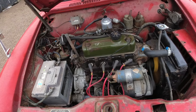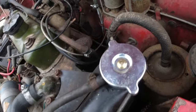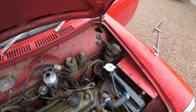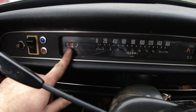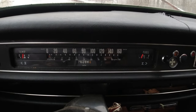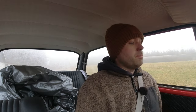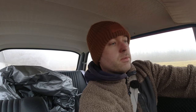It sounds so sweet, this little A-series — sounds really really good. Let's take it for a little drive. There are some private roads around here so no problem. We'll take it for a drive in the seat, see what it does, get a brake feel, see if it goes up to temperature and if we get some heat in the cabin. Temperature gauge started to move up so the thermostat should open pretty soon. I have a little bit of fuel in it — I think that's like five liters — enough for a little test drive. I've got my fixed seatbelt on here. Fire extinguisher. Roll the window up and see if we have a heater. Oh, I'm getting warm air up on the screen — that's really good. Let's go for a drive. Wipers? Yes. Bad blades but they work.